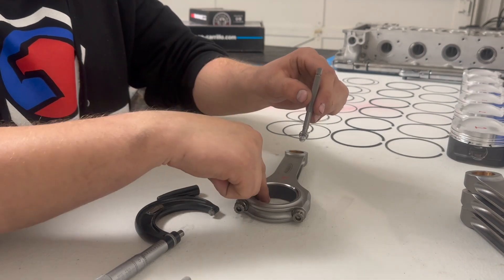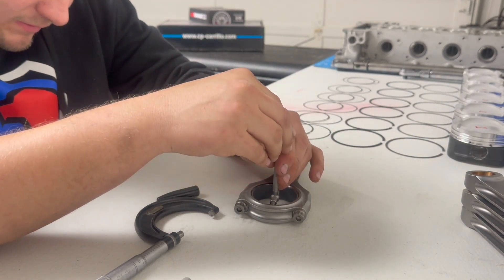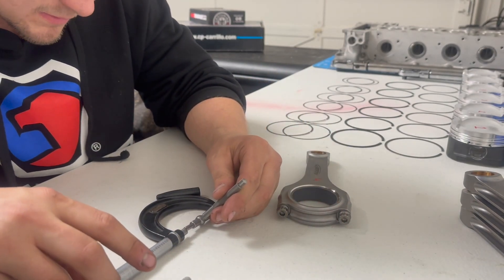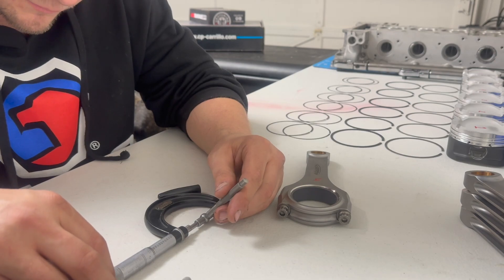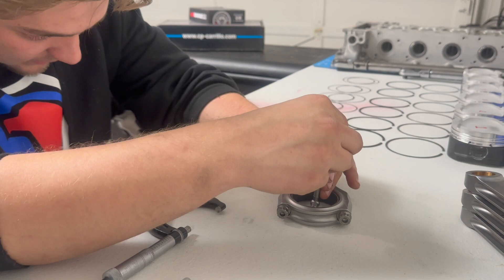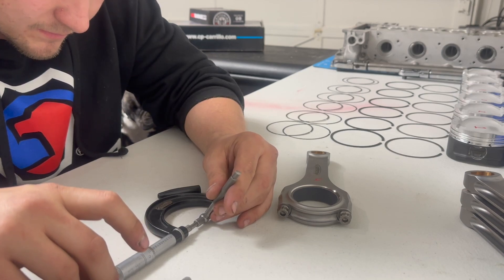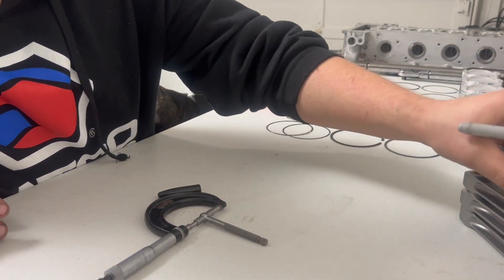You can measure these at a different angle — I'm doing them all straight up and down right now and I'll probably do them at an angle after just to be 100% sure. So T-gauge back and forth, make sure it's fully extended. Then twist the mic right until you feel it stop. That one's going 1.969 — it's slightly below 70, so I may not have gotten it completely square. Yeah, that feels better — stopped right at 20, so that's 1.970.